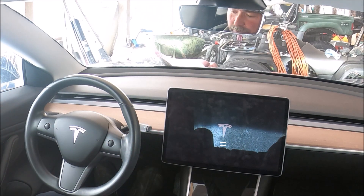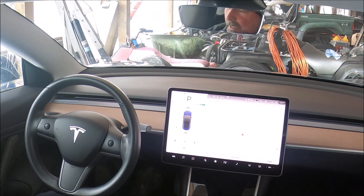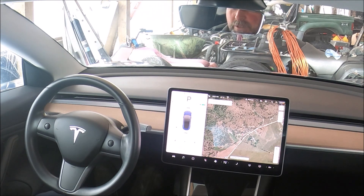When the Tesla T appears, you can let go of the scroll wheels and wait for it to power up. While you're parked, you don't want to be charging. I was instructed by a Tesla employee to do this reset while I was supercharging, and they said it was fine — but it didn't do a proper reset because we were supercharging at the time. So you have to be unplugged from any charger whatsoever.